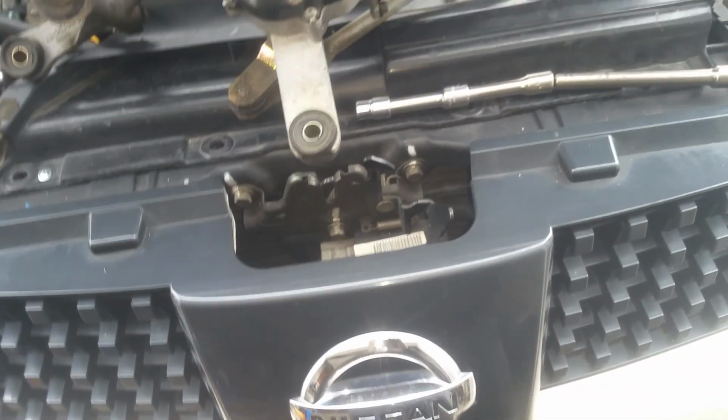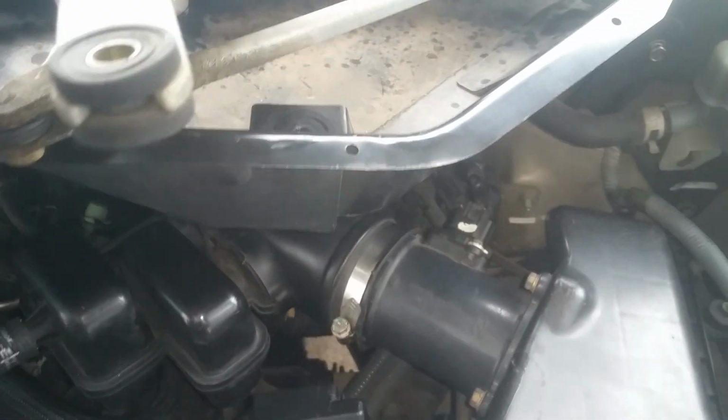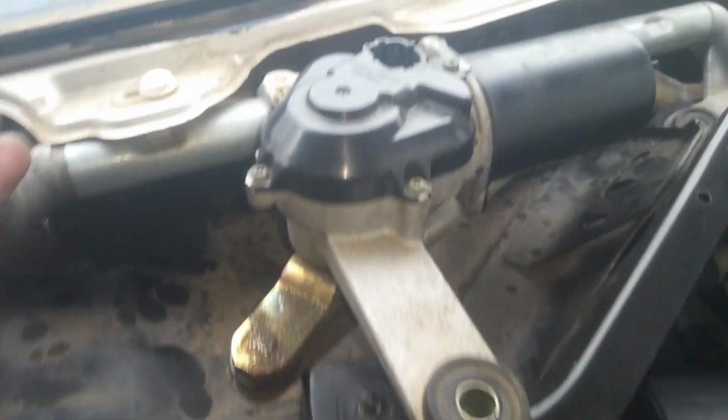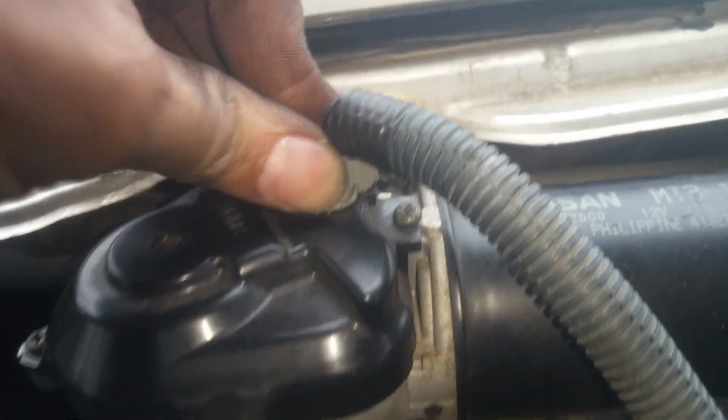So we got our windshield wiper motor. We got these 3 bolts, and we just got to get those put back, and this thing will indeed line itself up once you get it into place and get it bolted down. We just gotta slip it back. Just like so, and then we'll just get our bolts in there and we'll snug these down. Okay, and there that is tight, and it doesn't have to be just terrible tight. It's got little rubber grommets that go on it. We're just going to get our wire back up in here, and this thing just fits itself back around this and seals off, keeps the dust and stuff out. And then we just get this back up here, snap that into place.